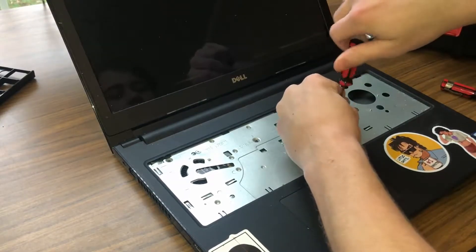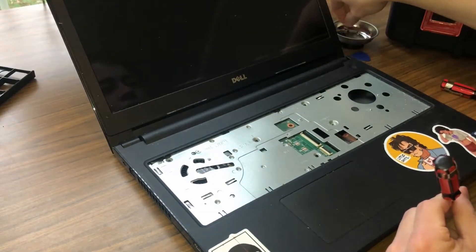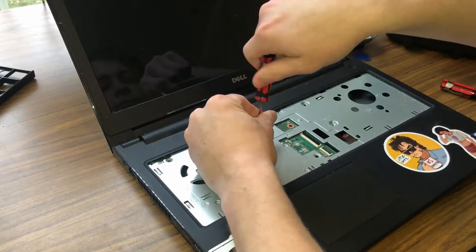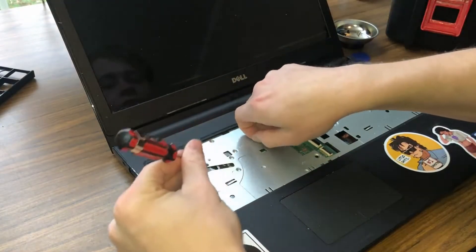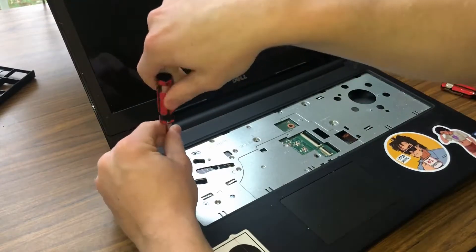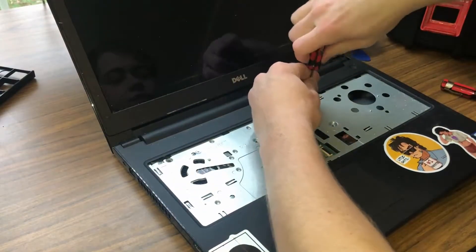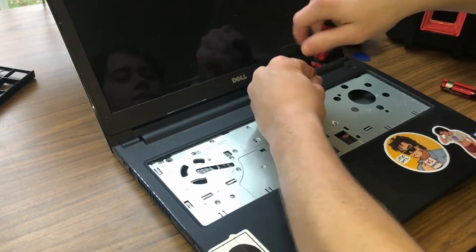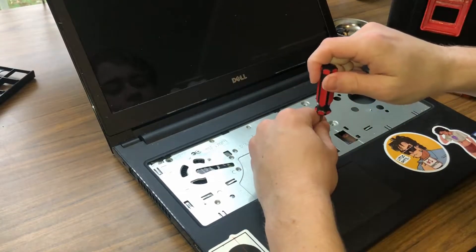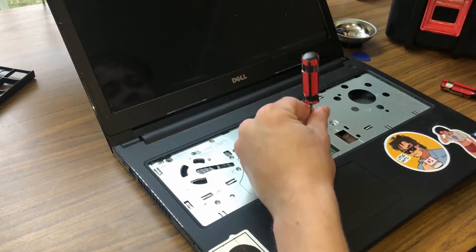For every laptop the concept is going to be pretty similar. This is probably one of the harder ones you'll run into because you actually have to take out the keyboard to even get to that port. Just look for the screws you need to remove. If you miss one or two, don't worry — take your time. If you notice extreme pressure when opening the case and it's taking too much force, you probably missed a screw. I completely forgot about the keyboard — I just woke up not even 30 minutes ago. If you're like me, you're bound to miss a few things, and I do this for a living.